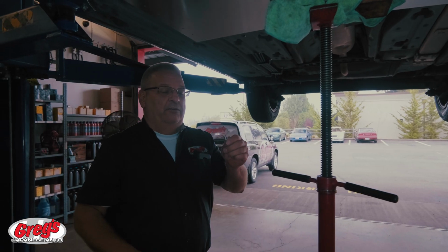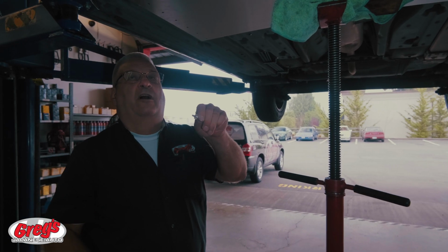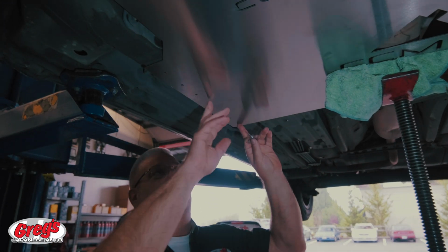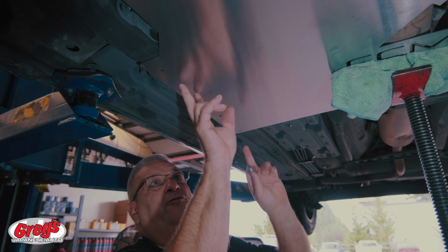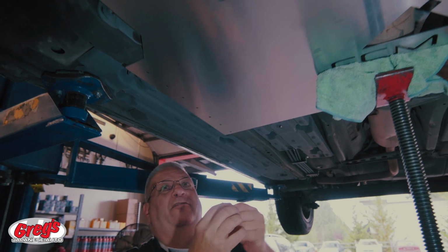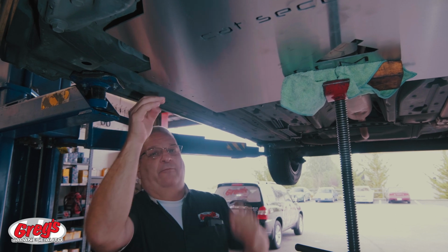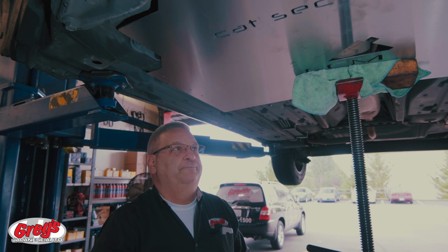So during install, you have your safety screws and you have your pop rivets on there. The pattern, you have a safety screw, and a safety screw. And you have 2 of the pop rivets in each one of these holes. So 3 screws, 4 pop rivets on each side to secure this thing.